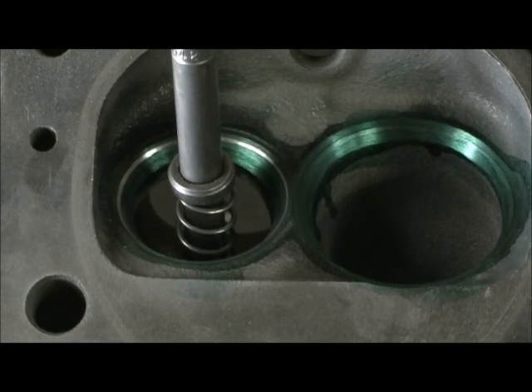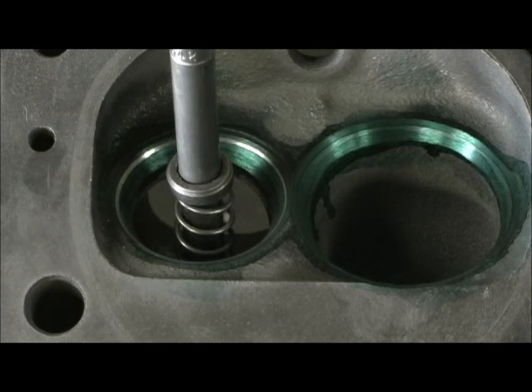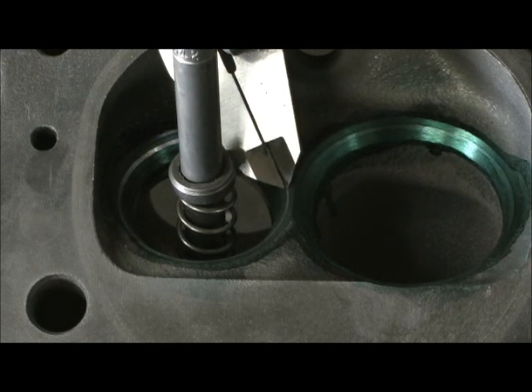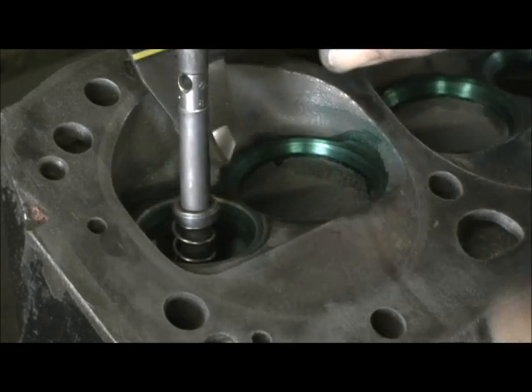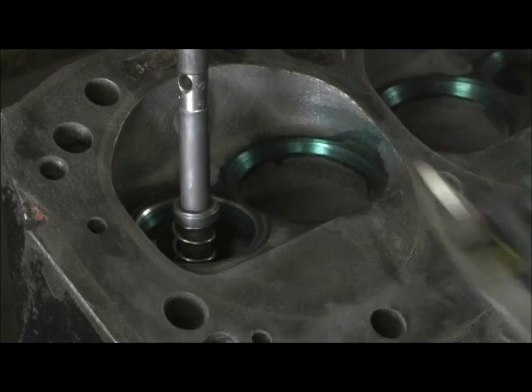There's our seat right there. Notice it's just a touch wider over here than over here — that tells us there might be a little bit of an issue of concentricity. Sometimes I have to go back with the 45 to get it. I'll take our measurement tool — just a caliper — and measure the width of that seat. It's got to be touched a little bit more; it's just 27 thousandths. Let's touch it again. That's going to pull it in exactly where it needs to be. Looks like 50 thousandths is what we got for a seat width. That one's done.